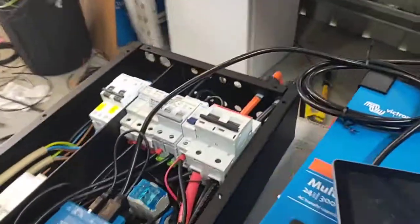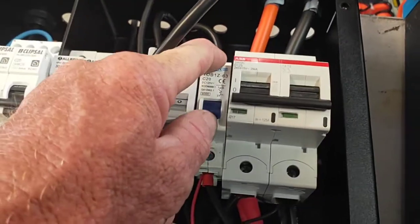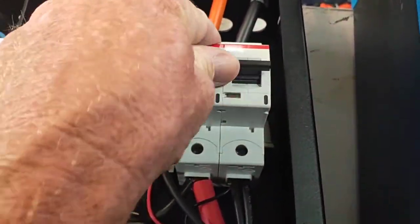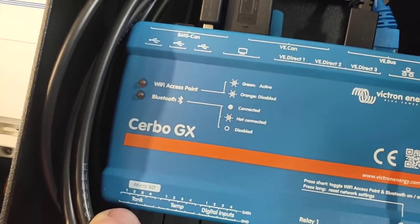Come over here. If you turn on the 24 to 12 volt — this little blue one — that's the 24 to 12 volt converter, but it also brings power on for the touchscreen and Cerbo GX. You've also got to turn on the main battery breaker, and we should see some lights start to flash as everything starts to wake up.